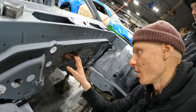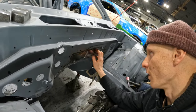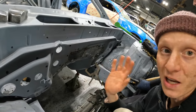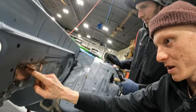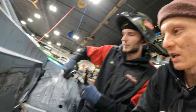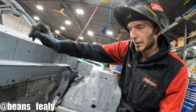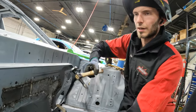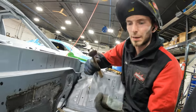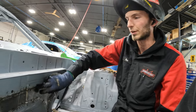Ben's been working away on this firewall for the last two or three hours, and it looks like maybe one-third of it is fully done before it gets ground down and becomes seamless. So why does this take so long? Why can't you just lay a huge bead around this and call it a day? Because you have to work inch by inch — as the weld is done, it shrinks the metal, so afterwards you have to hammer and dolly the weld out to stretch the metal back out, which is how we get the nice smooth finish.